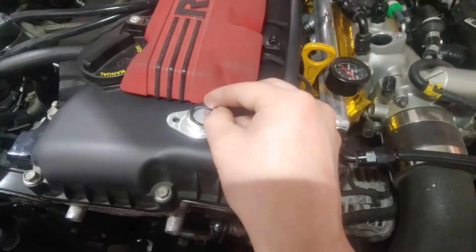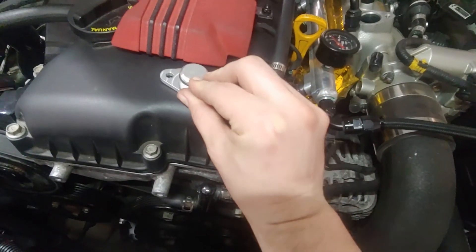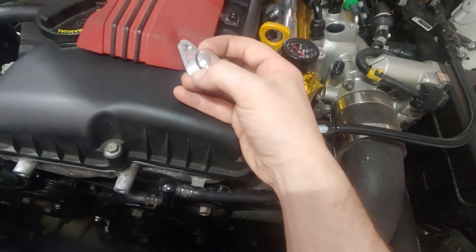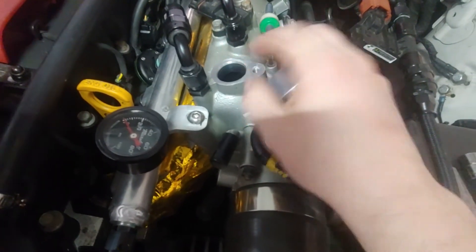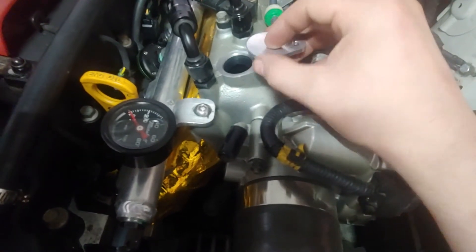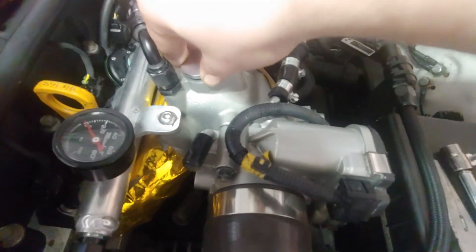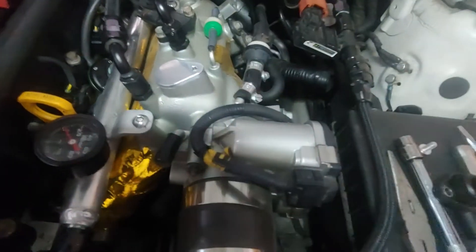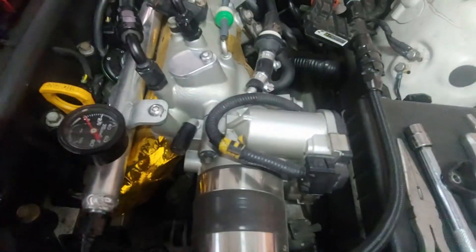I took a pick and pulled the o-ring off of the stock one — there we go. The o-ring goes on here, and mine's already got a little bit of oil to lubricate it. There's also a little chamfer in here that helps ease it in, but I always recommend lubricating it — you don't want to end up with a torn o-ring. Just work it into place — there you go — and then snug it into place with the new hardware.